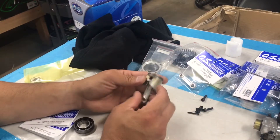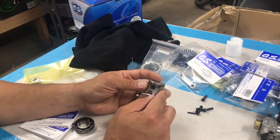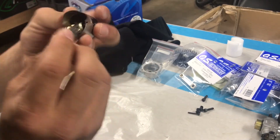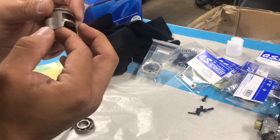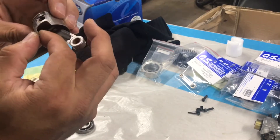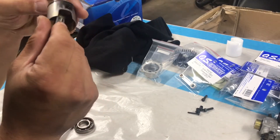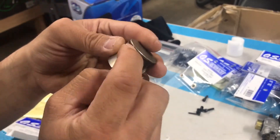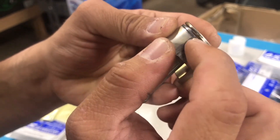So what we have here is a piston — I actually take the ring out before. It's all marred up and was actually bent too. It skimmed the side of the liner — you can see there's a line here and then that line disappears because it shaved it down.